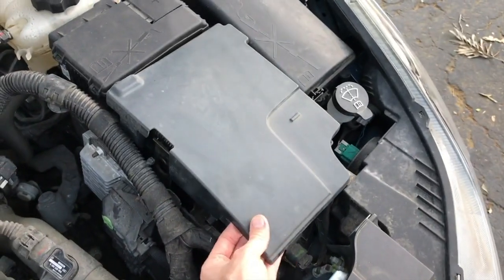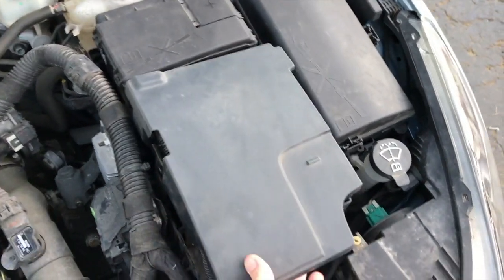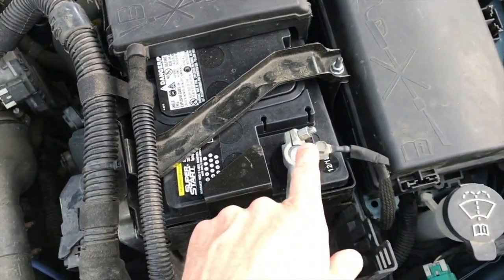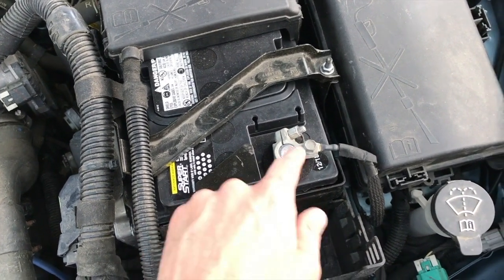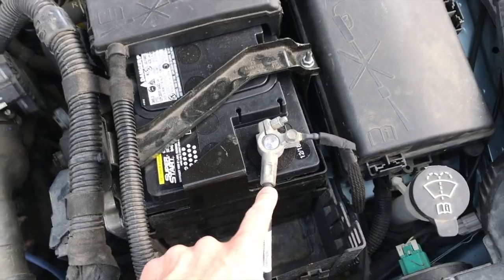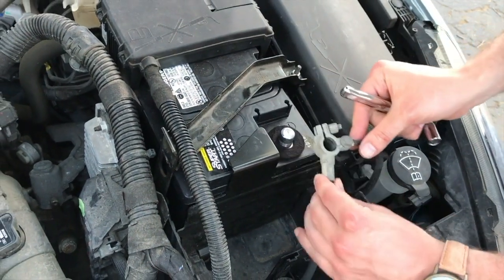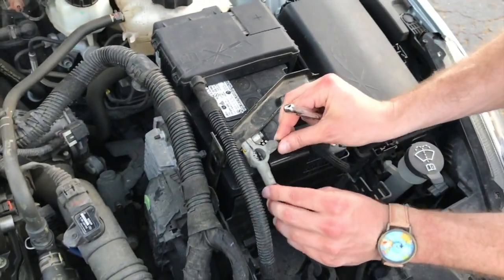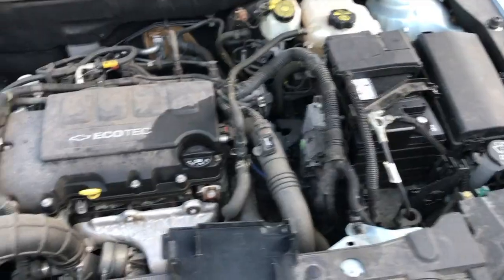Inside there you've got a little case or protector on your battery. It's got a few notches — just go ahead and carefully undo those plastic portions. Be careful, they're plastic and you do not want to break them. Once you remove that cover, grab your 10 millimeter socket and loosen up this 10 millimeter nut. You don't actually have to remove the entire nut, just loosen it to a point where you can remove the negative terminal. Set it in a safe location where it's not going to hop back up and gain contact with that terminal. At this point, all electrical power has been cut to your engine.